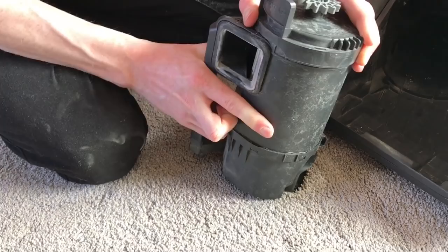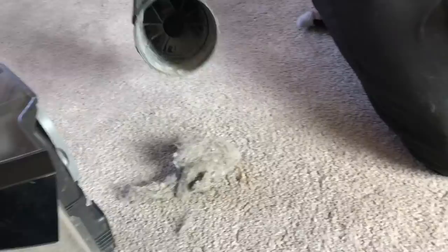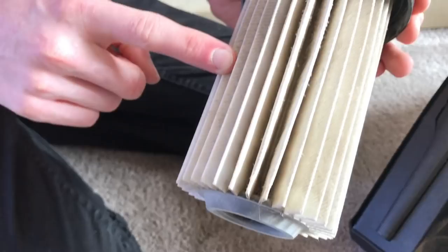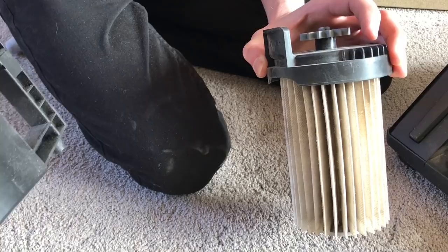And, oh my God. When you have cleaned the filter, the idea is the fine dust drops into the bottom of there. And then you take that out and you just empty out the fine dust. But realistically, it's filthy. It's absolutely filthy. I cleaned this yesterday. I took it outside. You're not supposed to brush this filter, actually, because it would probably make the pleats fluffy. You can wash it, but you're not supposed to brush it.